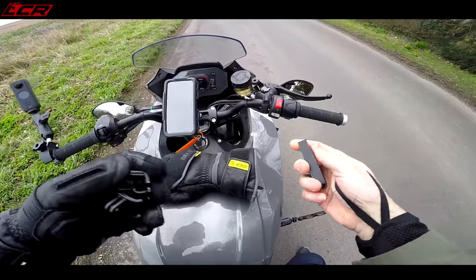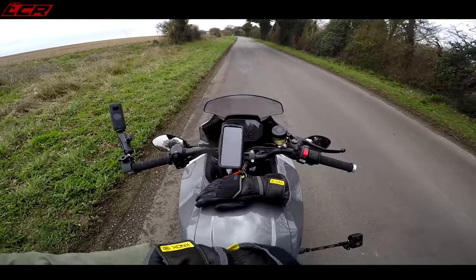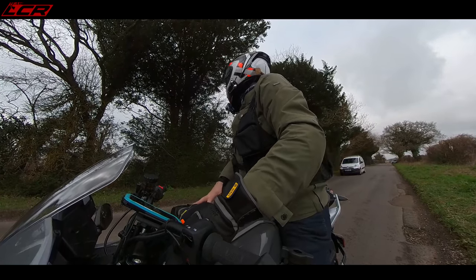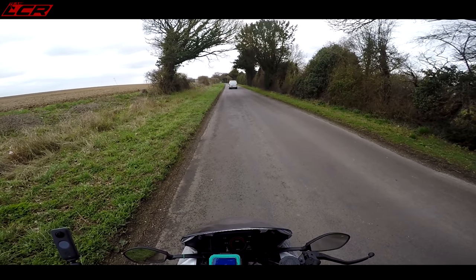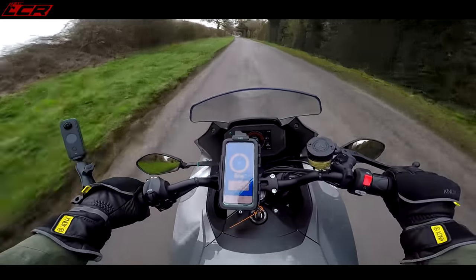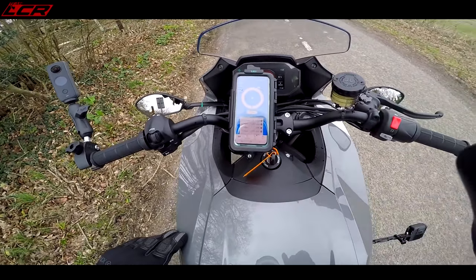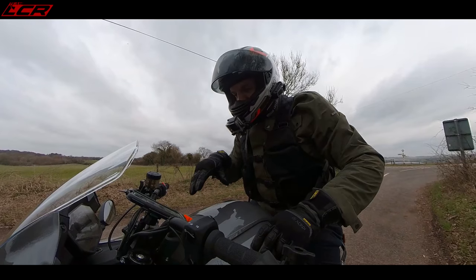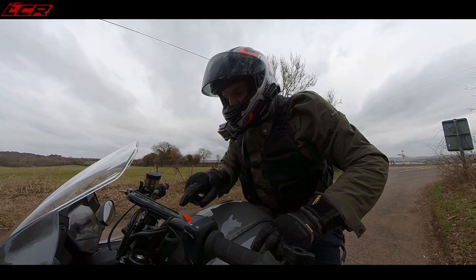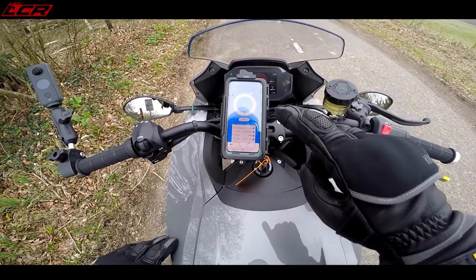My specialist timing equipment is called a Draggy, by the way. Someone's driving down my private test track — excuse me! We got a 0-60 of 5.27 seconds. I think that's because of the cold weather impacting it. The Street Triple R did it in 4.2 seconds. So Street Triple R: 4.2 seconds to 60. Quarter mile was 18 seconds, though that doesn't seem right. I think this bike would be at least as quick as the Street Triple R in warmer conditions — it just shows how much these batteries are impacted by cold weather.